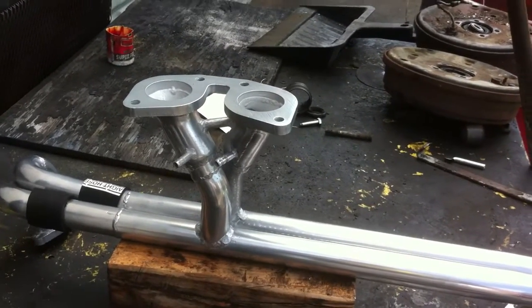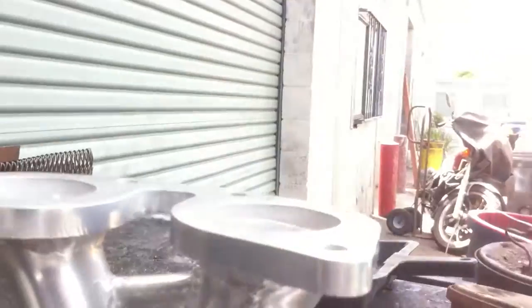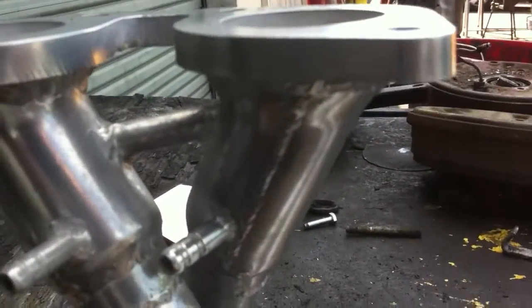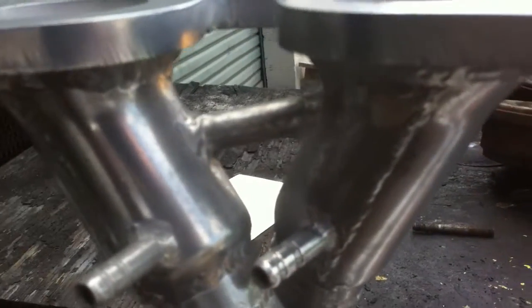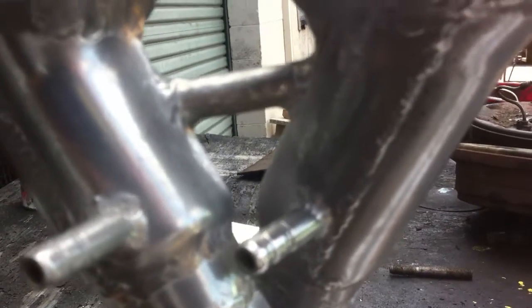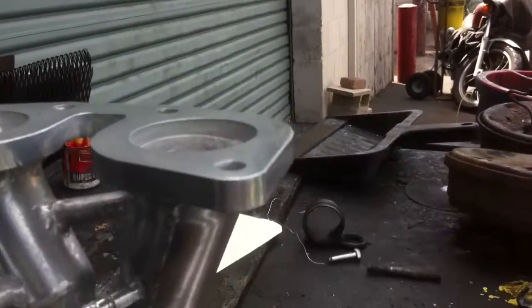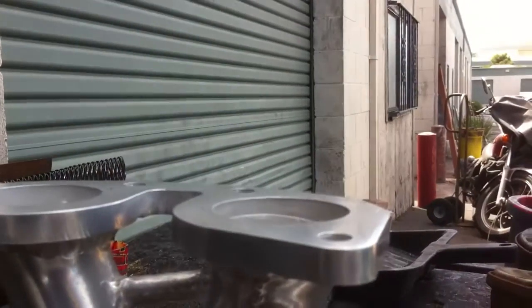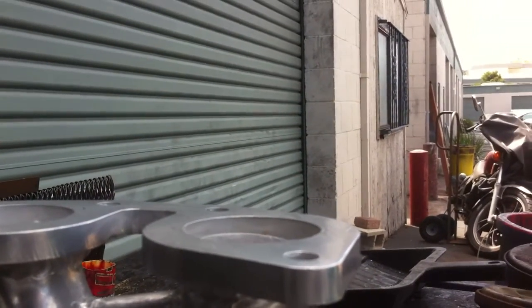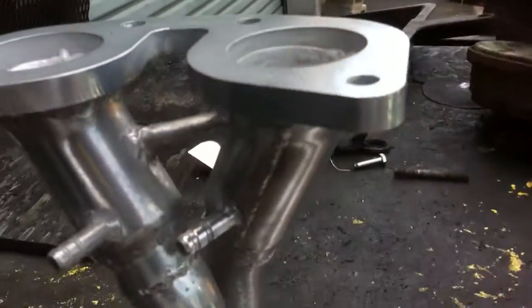This is the oil injected version. You can see here on the intake manifold — this one is set up for a 48 millimeter Weber, 40 to 48. There is the inlet. The inlet with oil pressure from the oil sending unit goes across the tube here into this chamber on this side and out. You can either run it into a cooler or run it back into the engine, but preferably it would be nicer to run it into the cooler. You're cooling the oil and you're heating the manifold — that's the purpose of this oil injection.